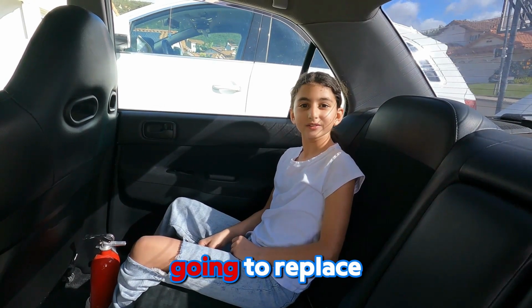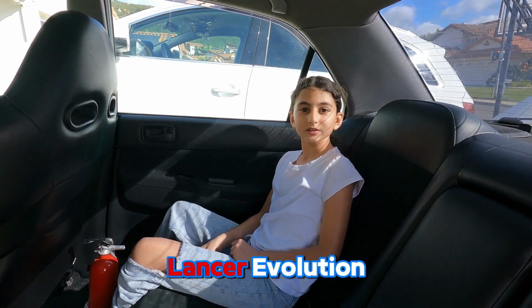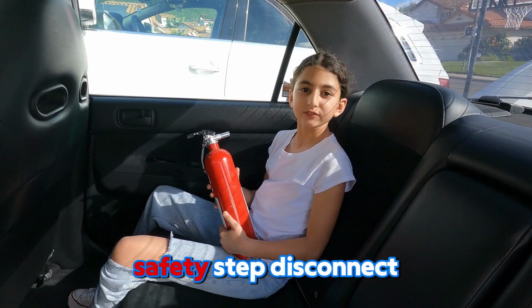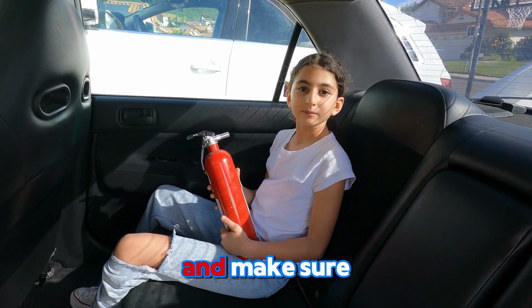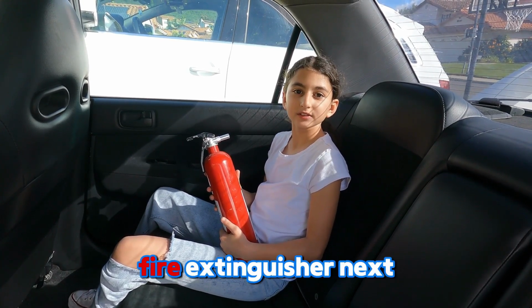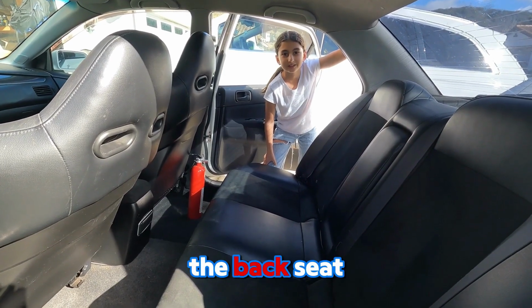Today, we are going to replace a fuel pump on a Mitsubishi Lancer Evolution. Safety step. Disconnect the battery cable and make sure to have a fire extinguisher next to you. First step, you have to remove the back seat.